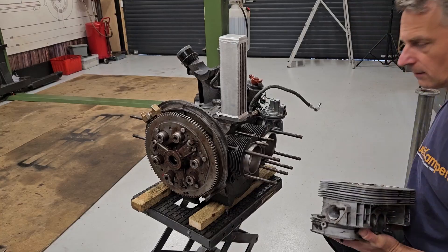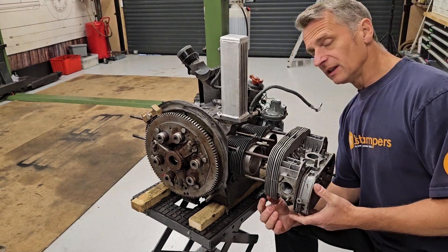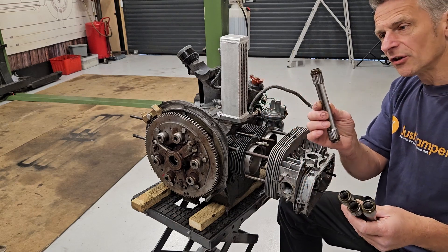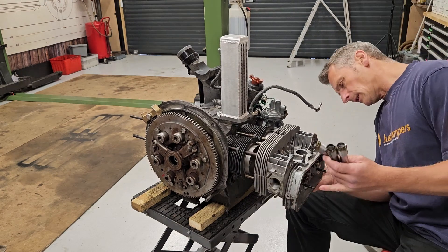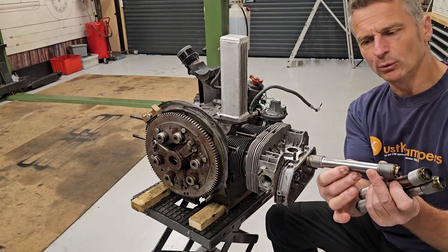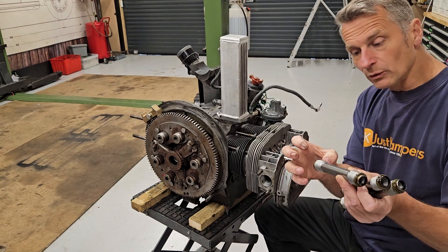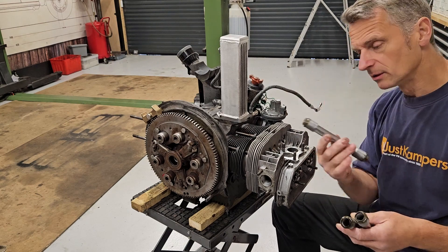Head time — slide it onto the studs just enough to give me room underneath to start sliding the push rod tubes in, and then slide it all together. These are our four push rod tubes already fitted with our new seals and a little bit of that liquid aviation-style sealer. A gentle wiggle and they're in. Incidentally, these tubes can be pulled out slightly depending on how far the cylinder head is from the block — they compress up when squished. If using your originals, wiggle that concertina piece out to make them longer again. Definitely use new seals, though you can reuse the tubes — obviously we've opted for new ones.